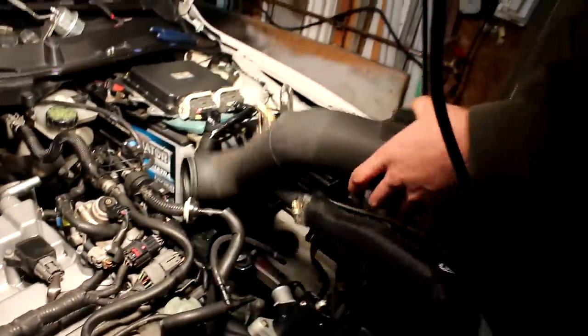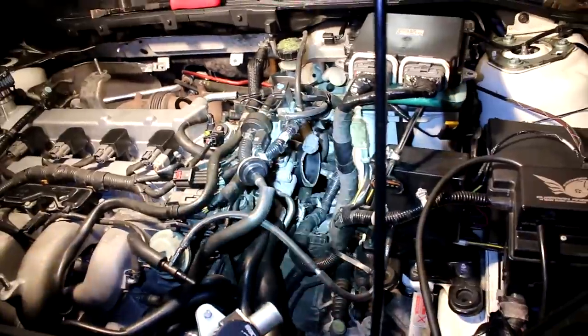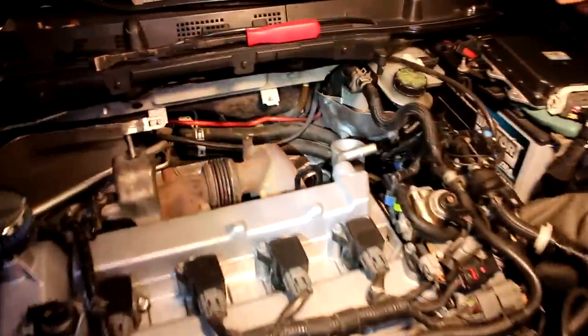See? We managed to get the intake out in a stress-free manner. That's all it takes, ladies and gentlemen. Staying calm and sober. It's a 3-inch HTP intake, so I had to buy a 3-inch to 3.5-inch coupler because the inlet on the BNR is 3.5 inches. Coupler's a bit beat up, buddy. Yeah, well, since it curves, I had to cut it in a little bit of an arch so I could bend the intake in the correct orientation with the proper clamping force from the T-bolt clamp. But it works, you know? It does the job. Unmetered air going in. No, my fuel trims are good. I don't have any check engine lights.